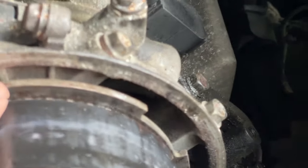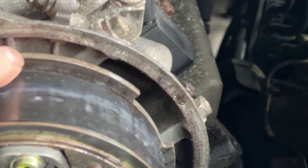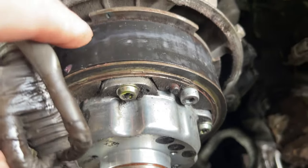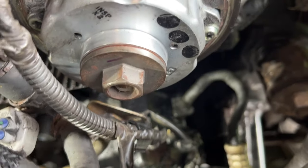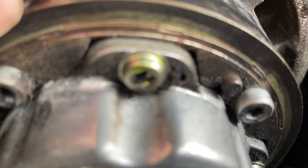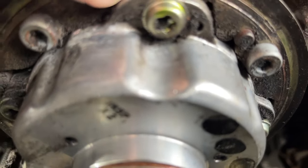And you see on the left cam, this has a very distinguishable green marker here. Line up with that marker, not the T. Again, not the T. Okay, here, not the T. There you go. So this points to zero. There should be a little hash mark, very noticeable. Right there, you can see it where my thumb is. A little tiny hash.